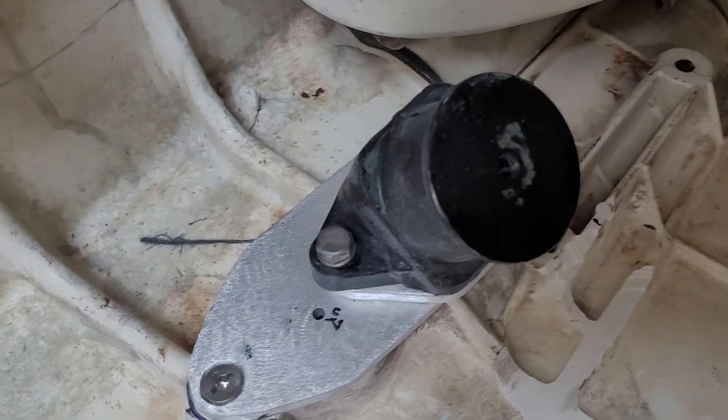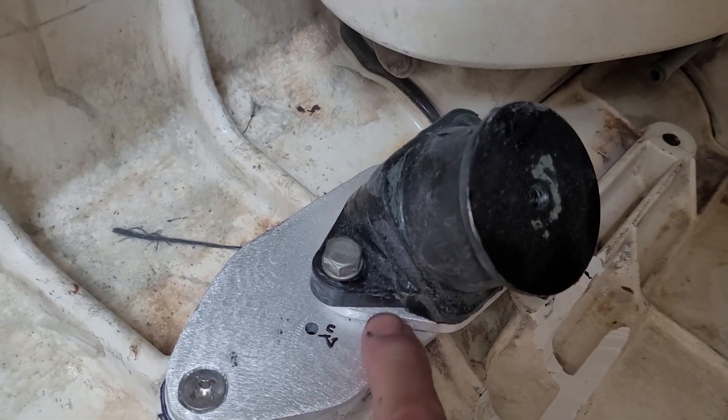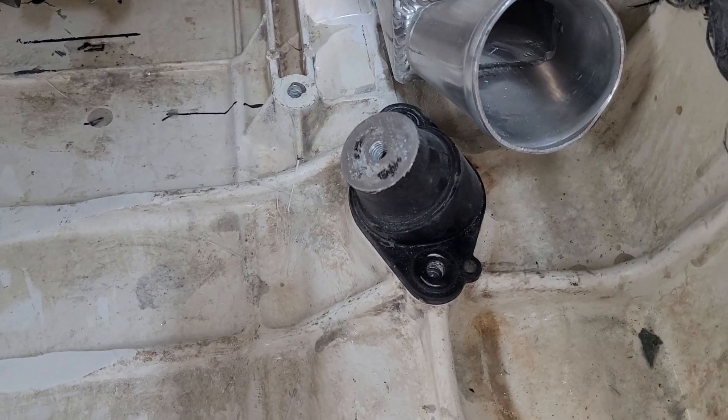On the back side over here in the corner, you have to raise this engine mount up with an aluminum plate. Use a Yamaha mount with another spacer plate underneath here — it raises the motor noticeably up on this side. Standard Kawasaki mount on that side.